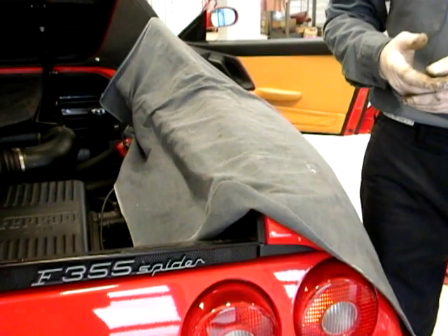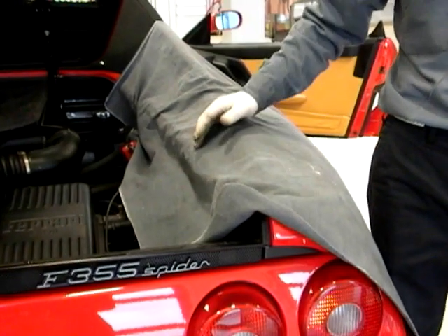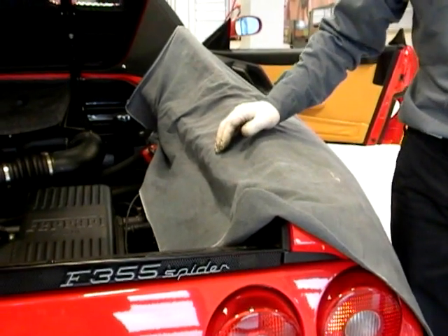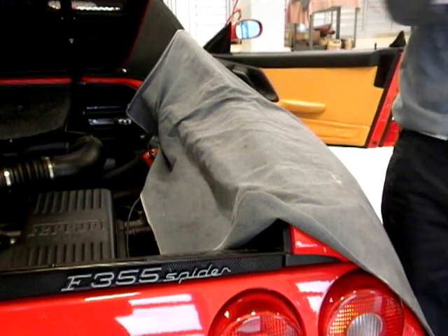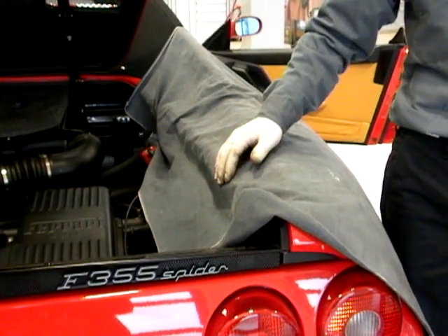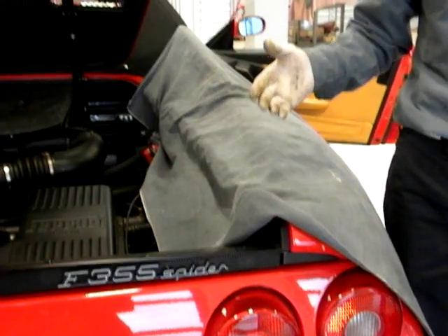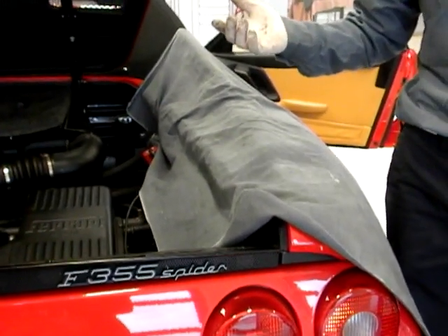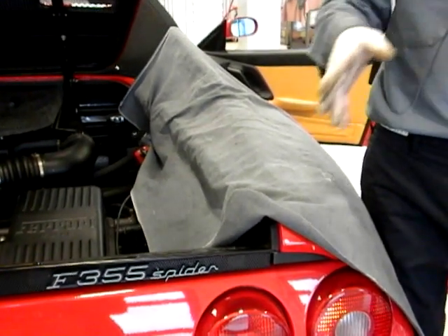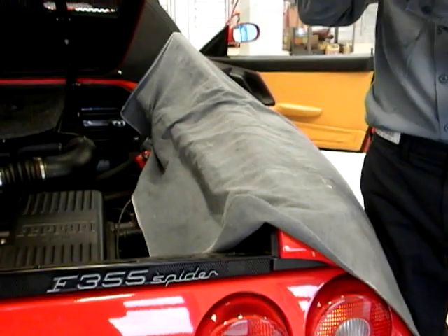On a really cold day, everything's really freezing cold in the garage - let's say it's 35, 40 degrees. All of a sudden getting close to spring, or a warm front comes in like what's going to happen this weekend. It's been 29 degrees, everything in your garage is super cold. Warm front comes in, it gets up to 55, 60 degrees. Go in your garage and everything is sweating because of moisture condensing, just like a glass of tea on a hot summer day. That's happening inside your engine, on those seats too, because that cold engine with moisture working its way through the tailpipe will collect condensation. That's why it's on the exhaust.